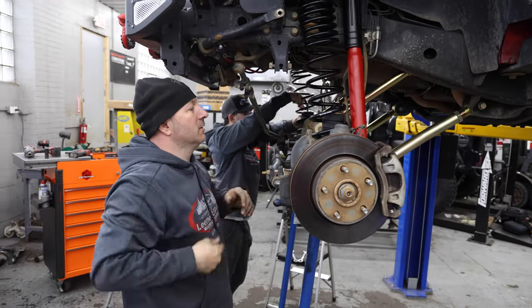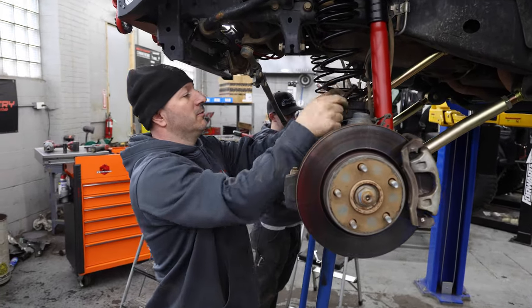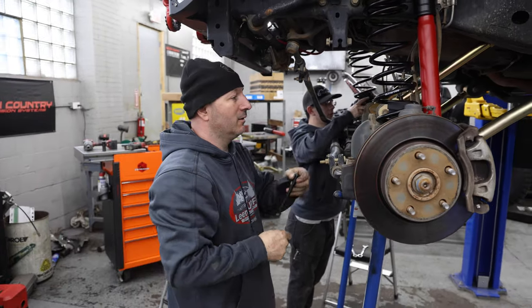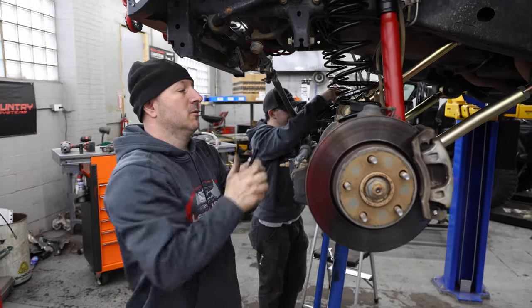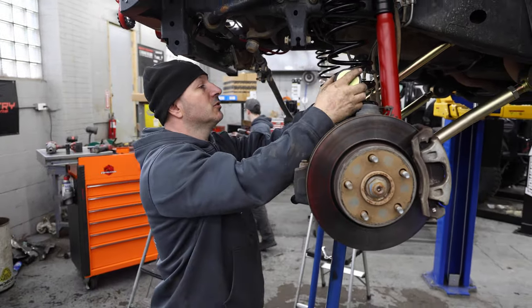Metal Cloak bump stops, you can easily take out some. I recommend four, but if you just want to take an inch out, you don't have to tear anything apart, you just pop an inch out. They give you longer, shorter bolts, so as you take them out, you've got your bolts to stick in there. But you should need 4 inches-ish. So we're gonna start with that.